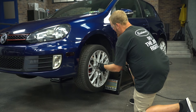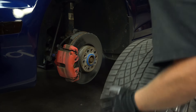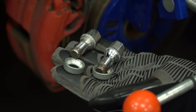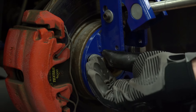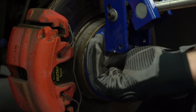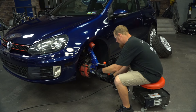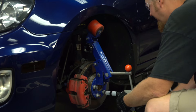Once the car is in the air, we ripped both those front tires off, and now we can actually start talking about the fender roller. The first thing you need to know is that if you're working on a German car like we were today, we give you spacers that allow it to work with wheel studs. This thing mounts up seamlessly — very simple. Get it installed, use your lug nuts or in this case studs, mount it to the hub of the car, and tighten it down in that same star pattern you'd use when tightening your wheel, and you're ready to go.